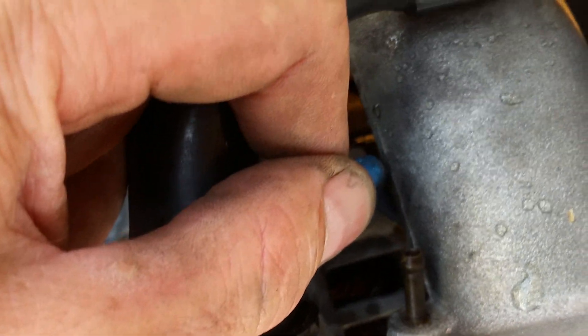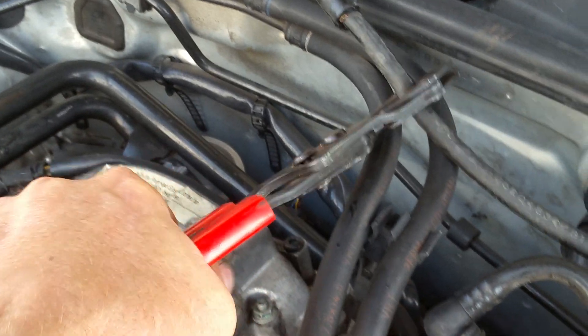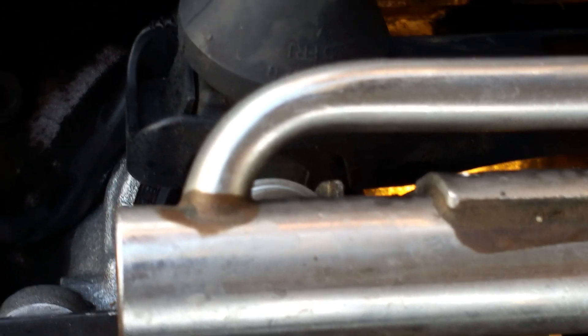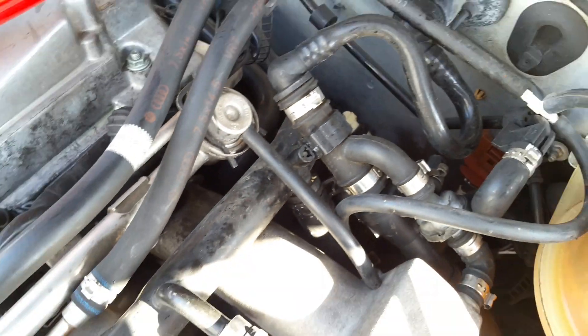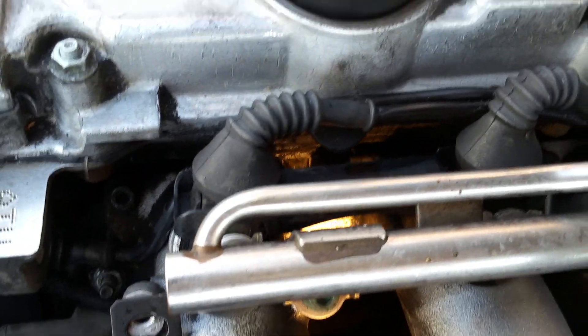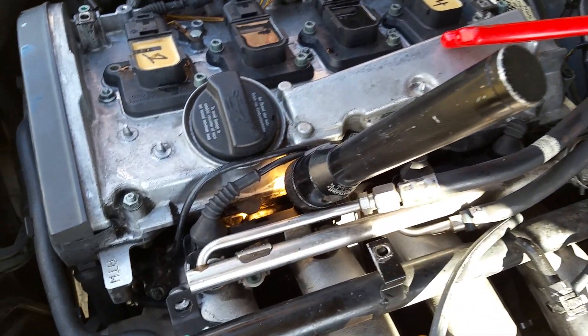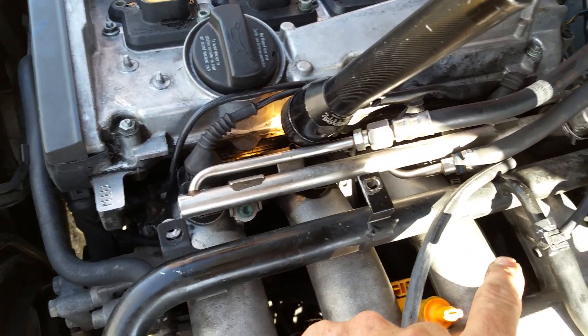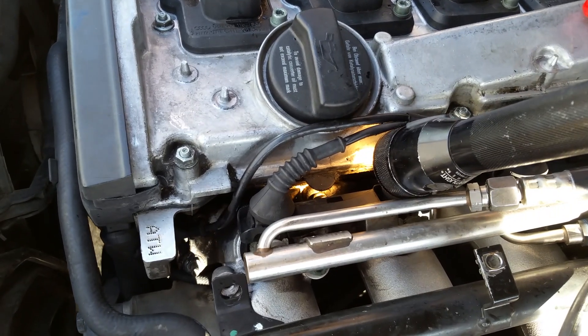It's hard to see the smoke but it is coming out. Crimp this, turn this on, let's see. There's some smoke coming out right there on the intake manifold gasket. This is probably going to be hard to see, but I established some smoke here — on the number two intake. See: one, two, three, four — number two intake manifold seems to be leaking. Seen some smoke coming out of there.